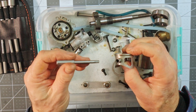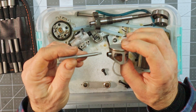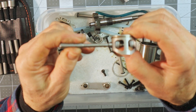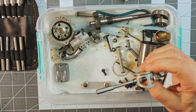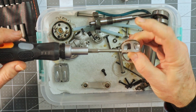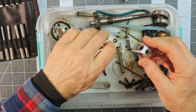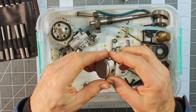The perfect tool for extracting this piston pin is one of these Torx bits — and the fact is that they're long. I had this idea of sticking this Torx bit in there because a lot of times what people do is try to find some kind of screw to go in and get a bite on it. These pins are not threaded — which in my opinion OS should have threaded them to make life easier. But this T25 Torx bit kind of fits in there. All I did was tap it and get it stuck in that pin a little bit, then heated and oiled it up, put the driver end on and started turning it. It was stuck in that pin and I just started turning it and all of a sudden it just came out. It just pulled right out and it was wonderful.